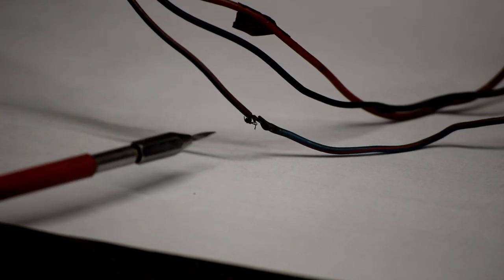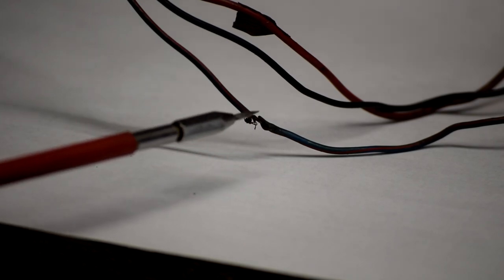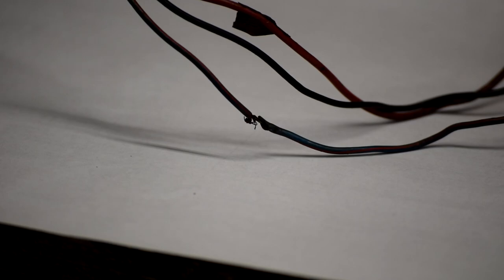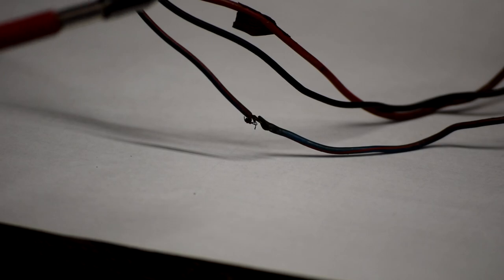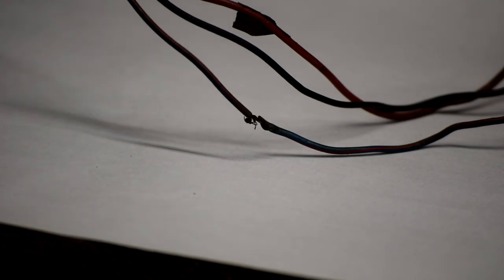Here I just want to show you some of the surprises you can find when you start working on these cars. This is the part of the OEM wiring harness that went to the cam angle sensor — and right here you can see it's all frayed and split. There are only a couple of strands of copper holding that on. I don't know how many of the problems I've been having with this motor relate to the fact that wire was all chewed up inside the harness — it was wrapped in electrical tape so you'd never see it. But now things can only get better now that the wiring harness has been replaced. That's it for now, thanks for watching.